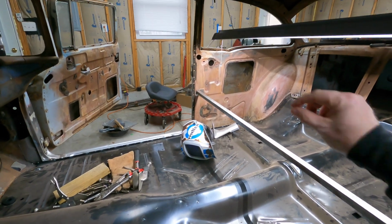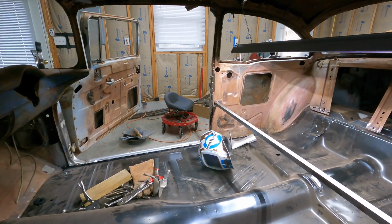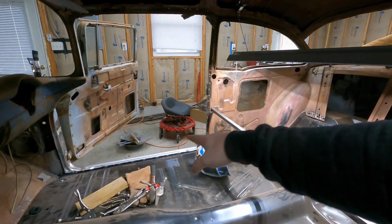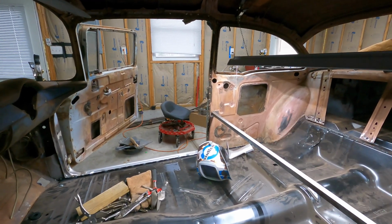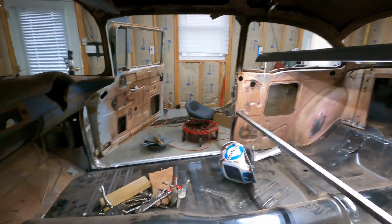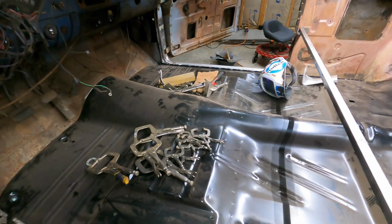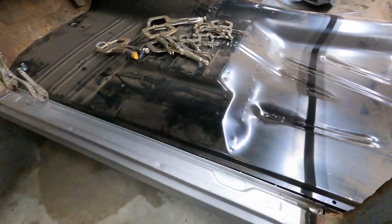That worked pretty well. Just used the jack and it squeezed everything apart, so it pushed the floor down and that bar up rather than just lifting up on the body, because that was where it had contact and was dragging a little bit on the flange on the far side. That was wanting to raise everything up. So got that done. This side mates up together pretty well. Got my little collection of clamps and stuff out. I just want to pinch these together and get going on the welding there.